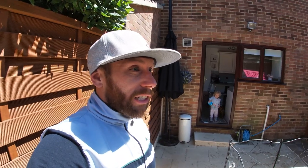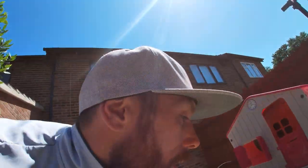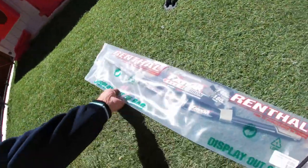I've got my light tires on there and I had no slashes or anything. I was running 26 PSI front yesterday and 28 PSI back. I generally run my tires quite hard to prevent punctures. I lose a bit of traction, but it's just what I prefer to run. So I'm just gonna give my bike a good once over now, check every nut and bolt, make sure it's all good. I just got my new bars that came through today.